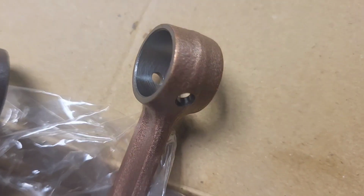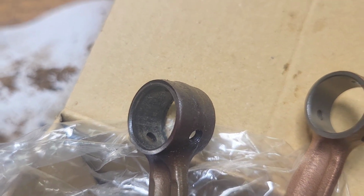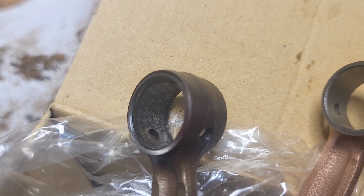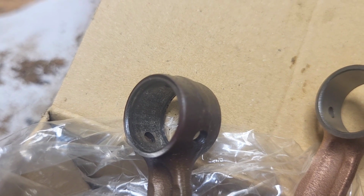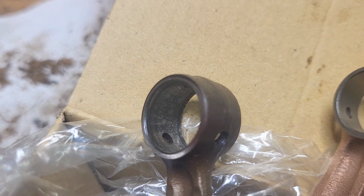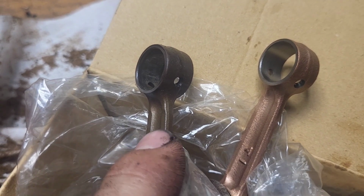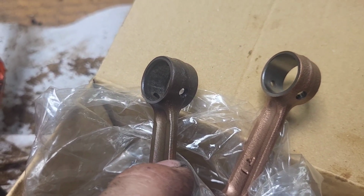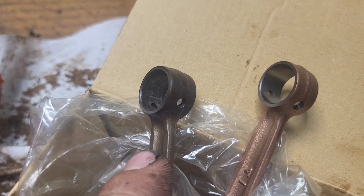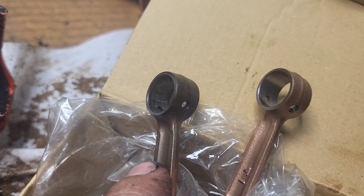Over here we get dull, I believe this is called spalling or embrittlement or something like that. It's just pretty much you ran sand in that bearing and it started eating away the surface finish of this. Most of this stuff is surface hardened, so there's a very thin layer of metal on the outside that's hard, and then it is at a hardness where it'd be stronger. So if you don't know, when you harden metal, it gets brittle.